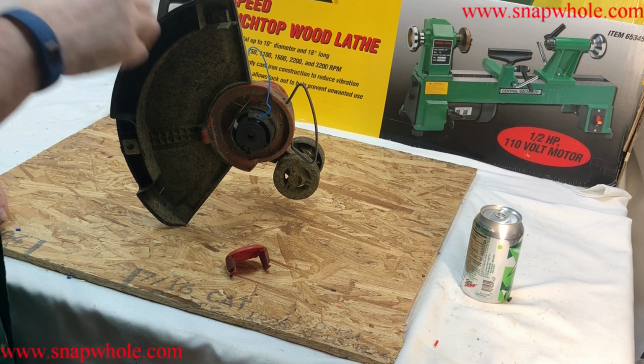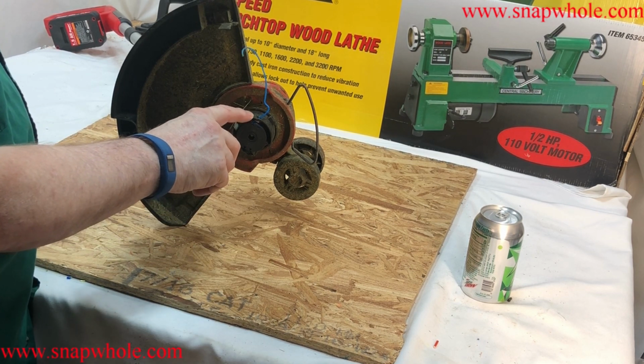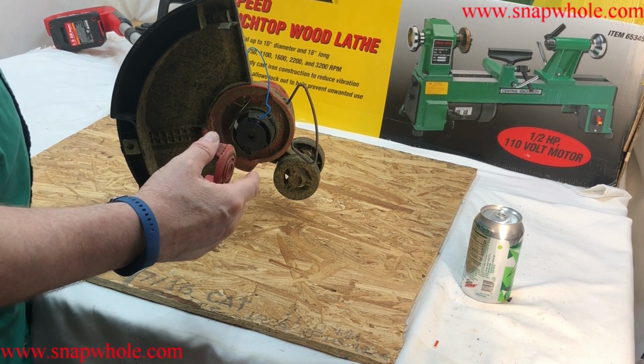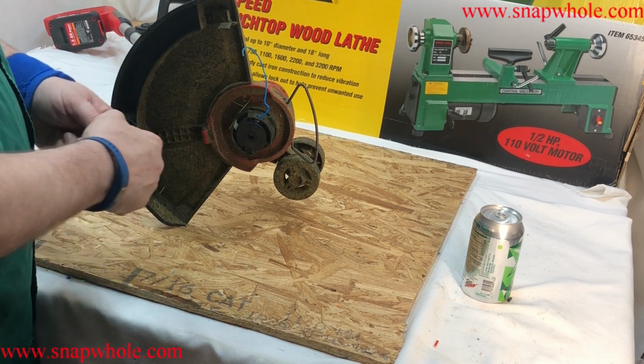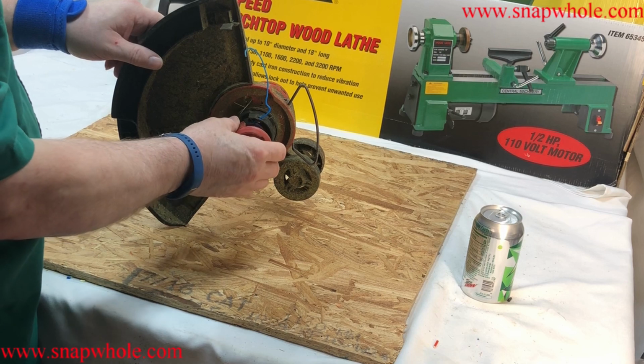So that is the number one problem with trimmers. When people complain about the line, I'll bet you if you check the line, it's unspooled and they've pulled it to respool it and not done it correctly.